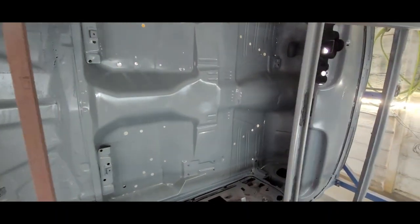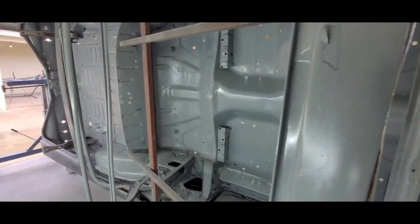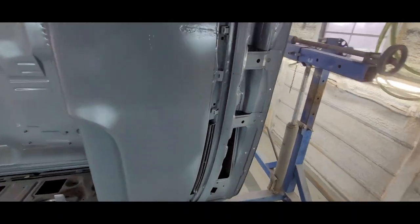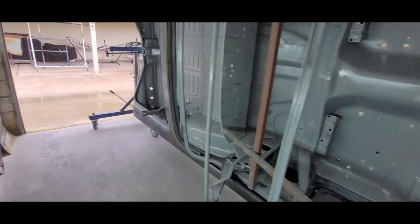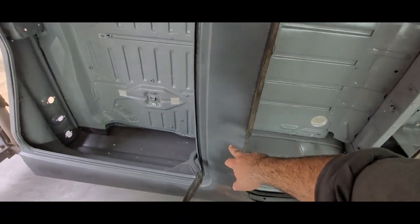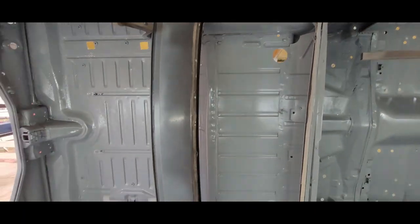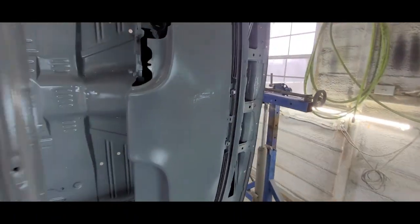So next up, I think I'm gonna leave this thing on the side and address all these little pinholes, figure something out, either put some all metal or cut them out, try and weld them up, see if they grow. I don't know. That's for the next video. And then we're gonna take the exterior down, the quarters and the doors, which should come off really easy. When the guy was standing over here and his hose kind of blasted a little bit right here, it took the paint right off instantly. So I don't think it's gonna be much trouble getting this down to bare metal. And then we'll get that in epoxy. I wanna get the whole thing in epoxy and then go from there.